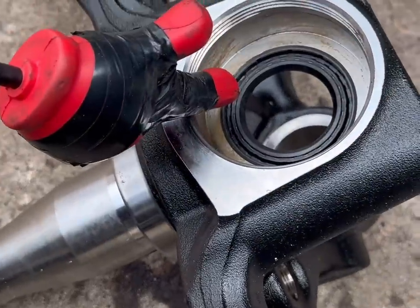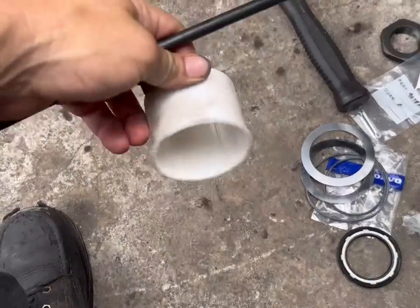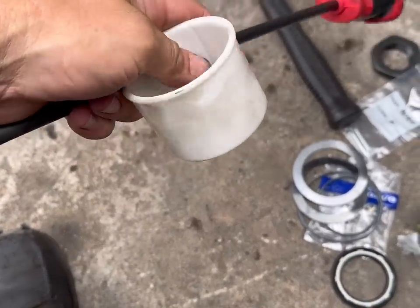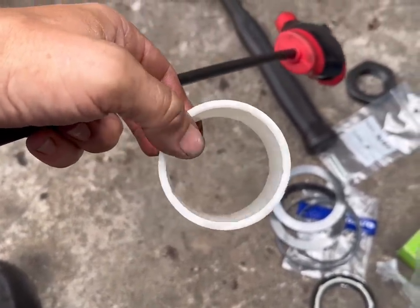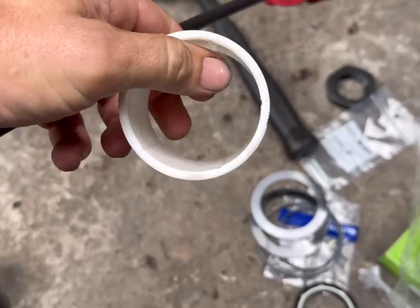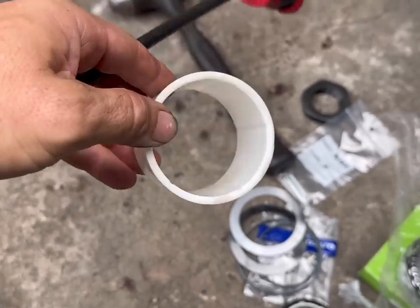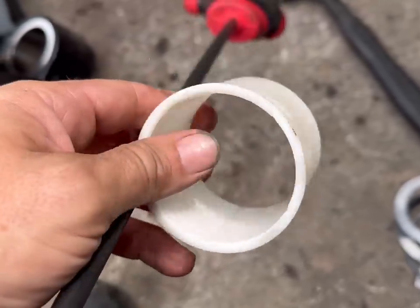We're going to install our rubber seal right here. This is your bottom bushing, okay? Now, the B&Ls and most of your heavier trucks have these. A lot of your VNRs and stuff like that have brass, so it all depends on which one you have and which one you get. So no ream. So this goes in the bottom.